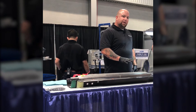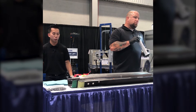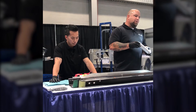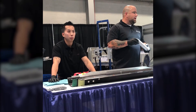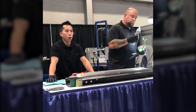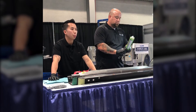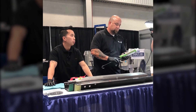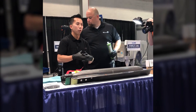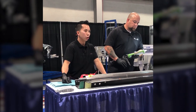Once we've chemically cleaned the piece, our next step is we're going to want to put a layer of K1. K1 is our structural adhesive from BMW. On all our adhesives, it's going to have a use-by date on them — you want to make sure to use it by that date. Also with K1, being the structural adhesive, they actually have an epoxy base inside of it, so it's very good for corrosion protection too. We want to make sure we cover every inch of that bare metal so we never have any kind of rust or corrosion issue, because there are epoxy properties inside our glue.